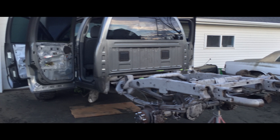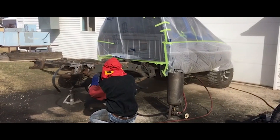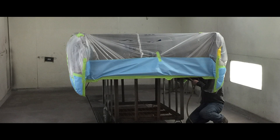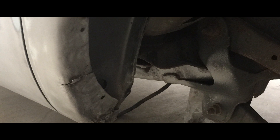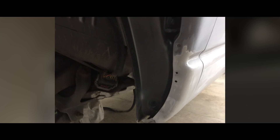That had led to the fender liners being torn up, and the bottoms of the front fenders being just destroyed — they looked like crumpled up tin cans. So what I ended up doing was stripping the body down, pulling the box and the doors off, and doing a complete frame-up restoration on the truck. I blasted and painted the bottom of the box, the bottom of the cab, and the frame with three coats of epoxy primer and epoxy paint over the top of that. I used all PPG products throughout the build, and then had to do some custom body work on those fenders. I ended up having them sectioned and moved back two inches, so I gained two inches of clearance. It's like how a lot of guys do a NorCal mod — just a more involved version, and I think it leads to a cleaner result.